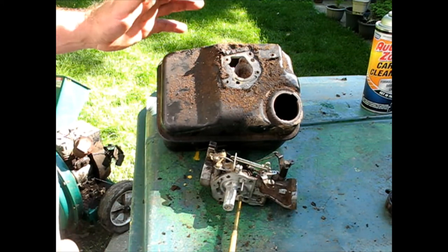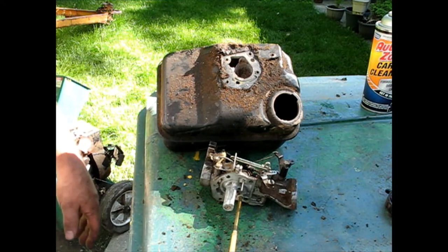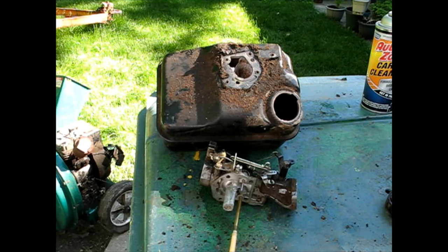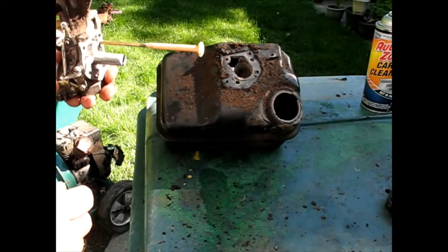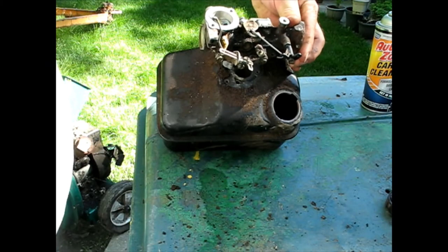Let's just say I fixed that tank my way — you can do it your way. Whatever works to fix a tank. Replacing it is the right fix, but it's a non-pressurized tank — it's only about four inches high, so there's really no PSI in there. Basically anything that makes it gasoline-tight is good enough. Worst case scenario, it drips out the bottom. I guarantee I used the right stuff to fix it. I'm going to reuse this gasket — I don't see anything wrong with it, it's not torn. All it does is seal the tank to this. A purist would have dipped this in chem cleaner and cleaned it 100%, but I don't see a reason to. The internals are what we're concerned about here.